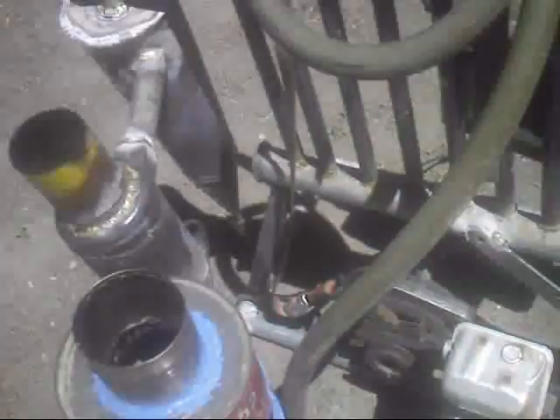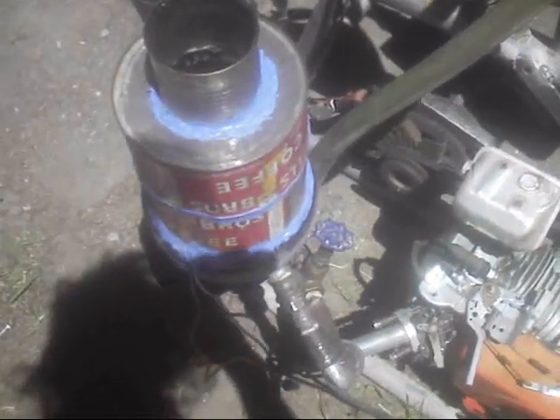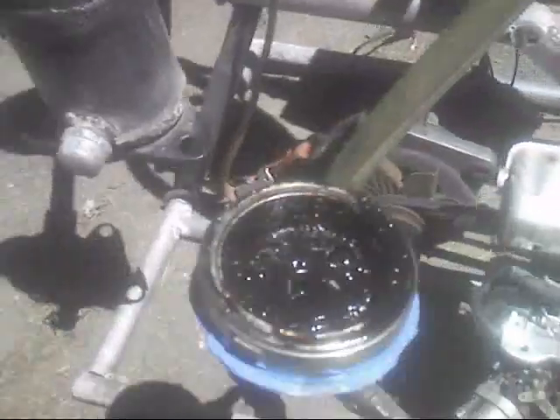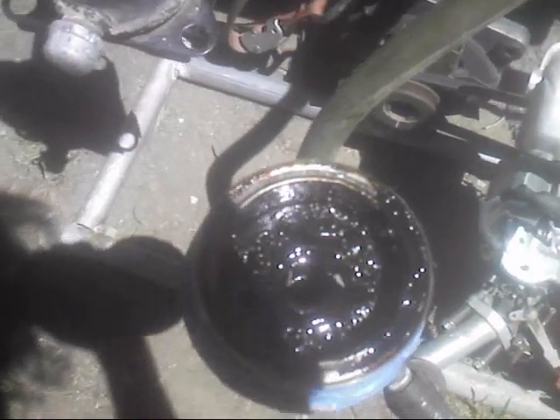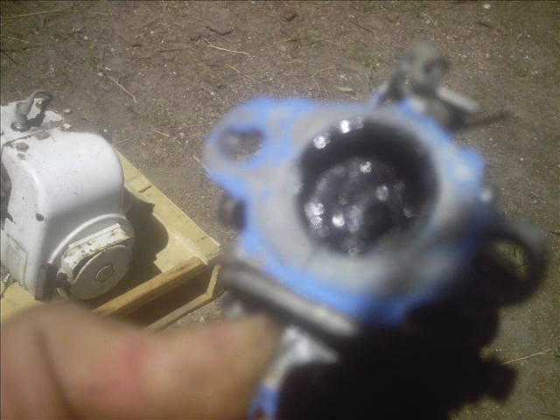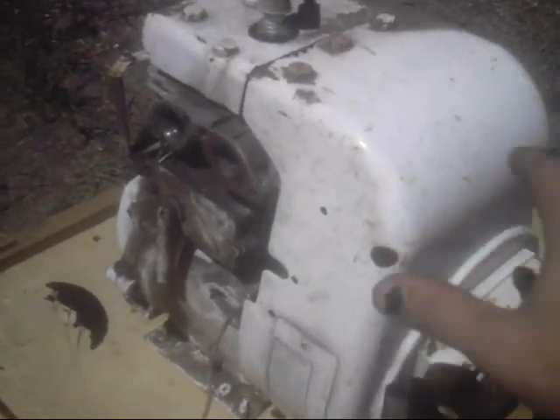Now, this can be done any various number of ways. Here's a short side note: here's an example of what happens if you don't have a properly working cyclone — this was from the previous model before I got the new cyclone. Look at all that nice juicy char in there. I'll show you a couple of clips of a throttle housing and a manifold. And then, what happens if you have a good running cyclone — we ran this 8 horsepower Tecumseh motor for 15 minutes and the intake valve is still clean.